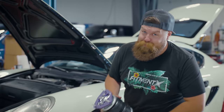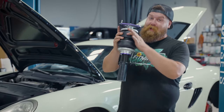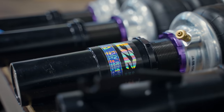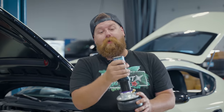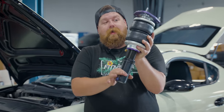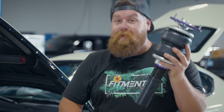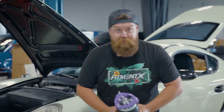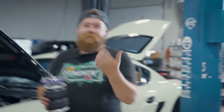Now that we've made a smooth transition over to the car, we're going to go over the air strut and take a peek at what we might need to do. So three bolts on top — that's going to mimic the stock setup. On the bottom, this is just smooth; there's no hardware in here because the control arm has a clamp that clamps this bad boy in. So there's going to be one bolt holding that in, plus the ABS and stuff like that, and then those three bolts on top. It should be pretty simple in the front — let's get the stock stuff out.